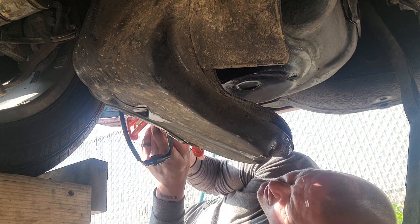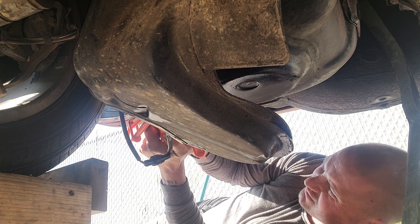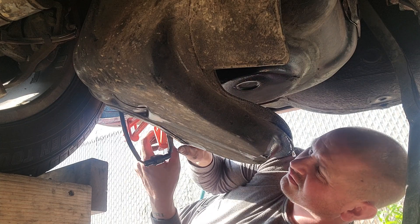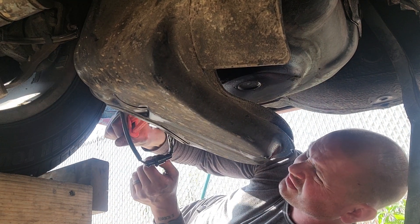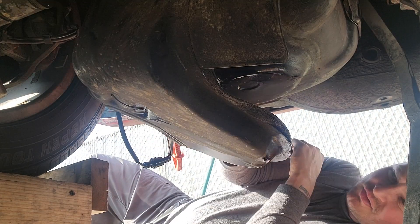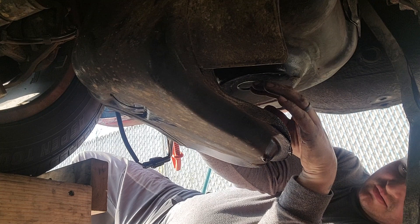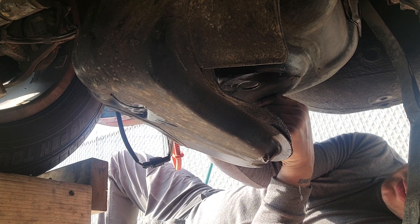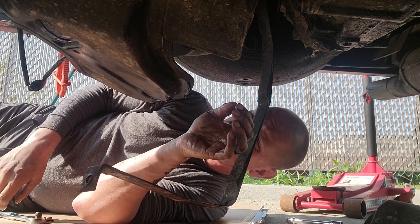The fuel line is just disintegrating. At least we found this now before driving around making fuel everywhere. The fuel line is so crusty and hard you can't even crush it. We continue trying to get the fuel pump loose anyway. We're going to need a clamp — we'll leak from the one side. Whatever fuel is in there, it'll drain and be empty on that side. I might need either a 19mm or 17mm for the tube fittings.